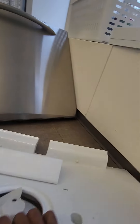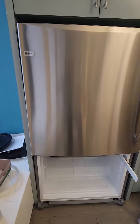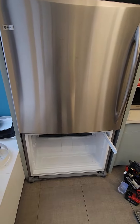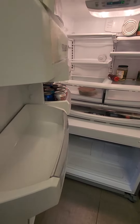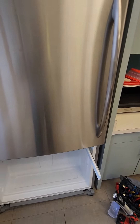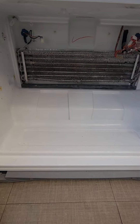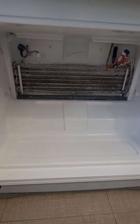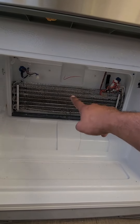So if you need a 36-inch refrigerator and you think you have to get the dual coil or twin cool version, try to get one of these instead. If you're not in the budget for the Profile, try to find another brand that offers the same technology — just one set of coils. I think it'll last you a lot longer than the one that has two sets of coils, one down here and one at the top.